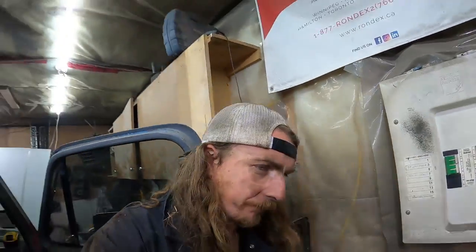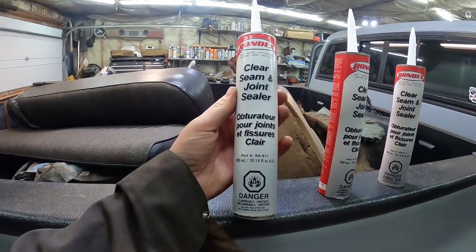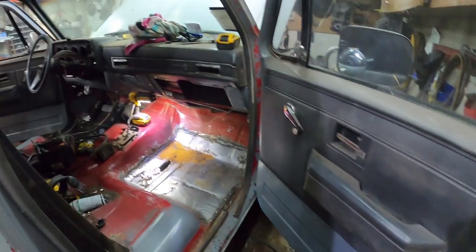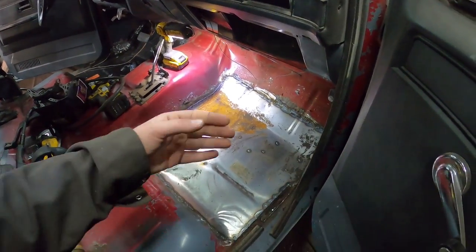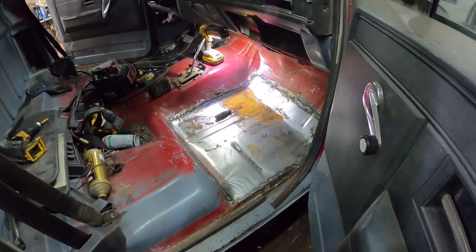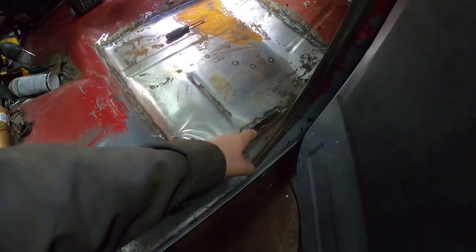I'm trying to jam - I was in the garage late last night, I was tired today at work. So I want to get a normal night's sleep tonight. This is what I use - seam sealer, Rondex. They didn't have any black so we'll try this clear, see if it makes a difference. I don't think it does, it's paintable. I'll grind this all down. That side I can do 100%, this side I still gotta weld the inner rocker in, but that's all this side needs, and it's really not that bad.